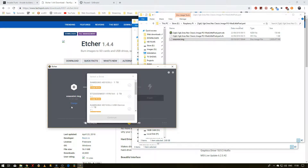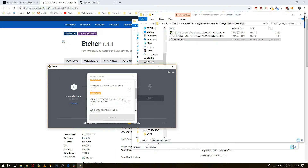You select your drive — USB generic storage device — select that one, then hit Flash and it'll flash the image onto the SD card. Then pop it out, stick it into your Raspberry Pi, and up comes your image all ready to go. All you have to do is set up your controllers, which it asks for straight away, and you're good to go. Thanks very much!